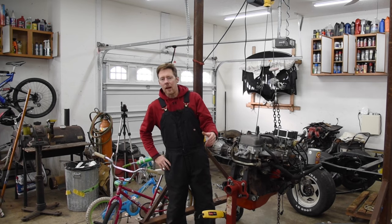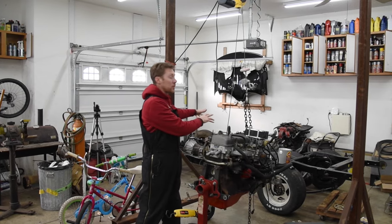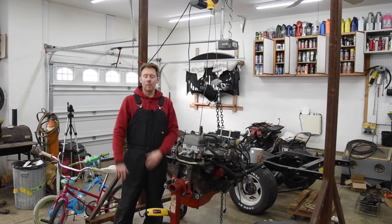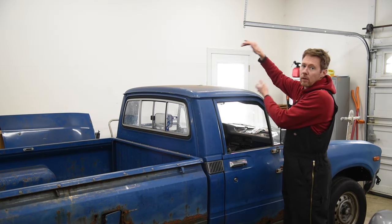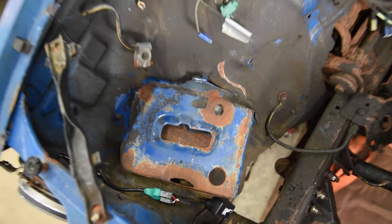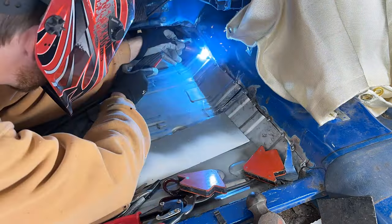So I just came to realize I got a little ahead of myself. In the last episode I talked about taking this motor and putting it onto the frame, bolting it up to the transmission, and having a fully built drivetrain and chassis — then just throwing the body and bed on and getting it running. The problem with that idea is that after I got the 20R motor in the other frame, I'd only be able to lift this cab about 18 inches from where it is now using the hoist, and that's just not going to be enough room to clear the top of that motor. Plus, I found some areas inside this cab that need attention — rusty pinholes under the battery tray, and I still need to finish the back side of that bottom wall on the back of the cab and make sure all the bottom side of the floors are sealed up and rust-free as well.